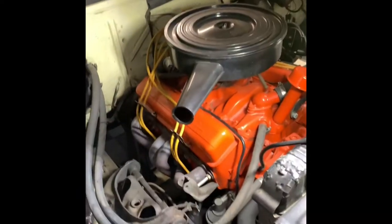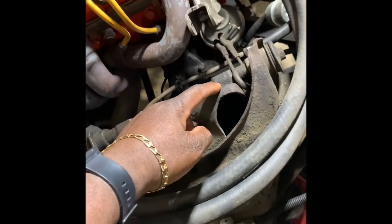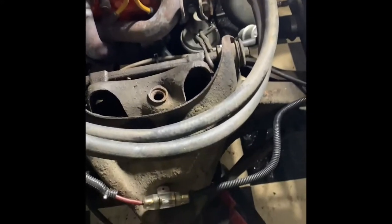As you can see here, I have my jack in place. This is a three-and-a-half-ton jack and I have it wedged under the lower control arm here. I'm just gonna raise it up slightly, and then this whole area will raise up. Eventually the upper control arm will slide up, and once this part is out I can just lower my jack slowly and it all just comes down safely. Let me get my camera in a good position so you can see it as I'm doing it.